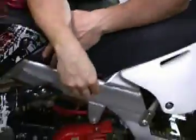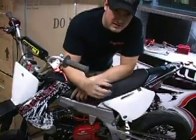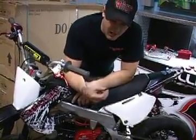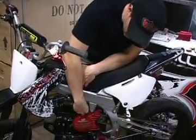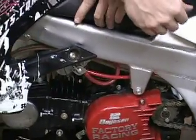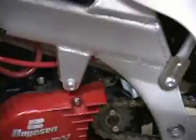Another thing you want to do is check your hoses. The hoses that come on Chinese pit bikes can get frail real easy. If you leave them out in the sun, they can rot really fast and pop off the petcocks or the carburetor. We put some new lines in. It's typically good to put new lines on pit bikes just as a preemptive strike against something that could fail on you.